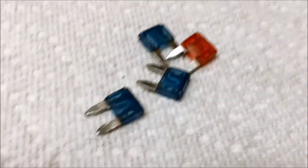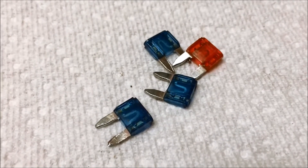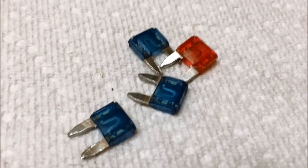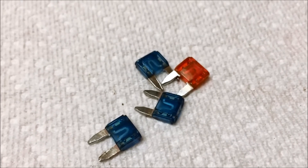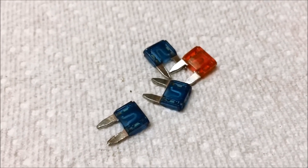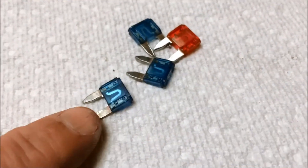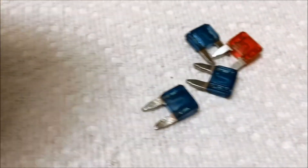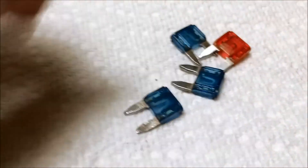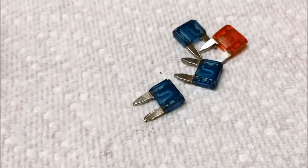My mother had a car — three or four years old — but she's a senior and it had 12,000K on it, and the radio died on it. I decided to check the fuse with an ohmmeter and found that the fuse was fine. But just as I was about to put it back in, I noticed that the prongs on her fuses were really discolored — almost like there was oxidization on them. So I cleaned the fuse on a wire wheel, plugged it back in, and lo and behold, the radio worked again.